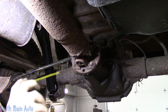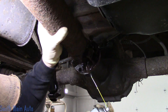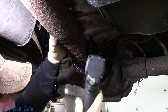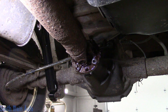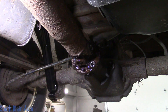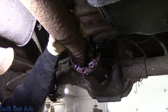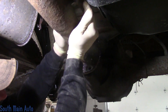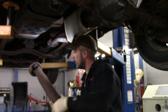That other shock is done. Now we have to remove the rear drive shaft — a little spritzer of penetrant down, a little spritzer from the back side. I'm going to zip this drive shaft out now. These are 12mm 12-point — somebody's already had them out before, sweet. These suckers have blue loctite on them, but being a '94 you know they've been out before. If they are loctited, a lot of times you've got to get just a smidge of heat on the back of that flange. Not bad — look at that.